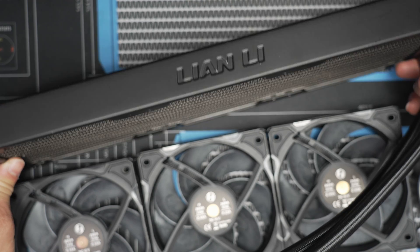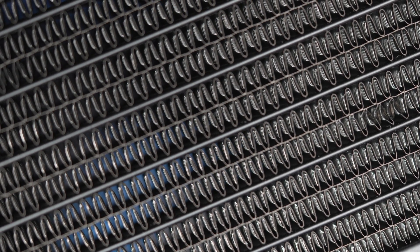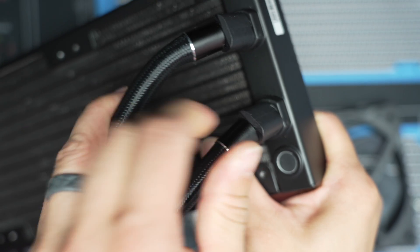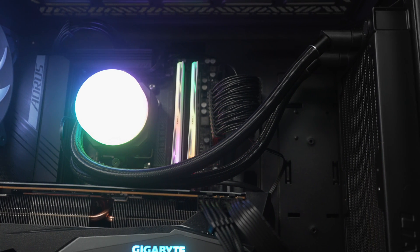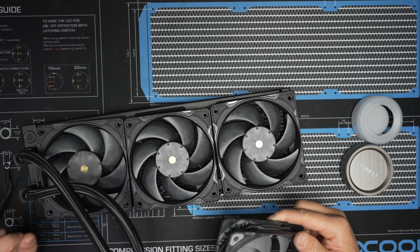Highlights: you've got a thicker rad — this one is 32 millimeters. The heat fins have a second layer they call double stacked, essentially a second set of smaller heat fins stacked underneath, which increases the contact area for heat exchange. At the radiator end, they've built in 45-degree swivel fittings, allowing the tubing run to be more flexible, although they add quite a bit of height. Fitting it into a compartment like the TD500 can be challenging if you want the elbows down. The AIO fans are 28 millimeters thick.